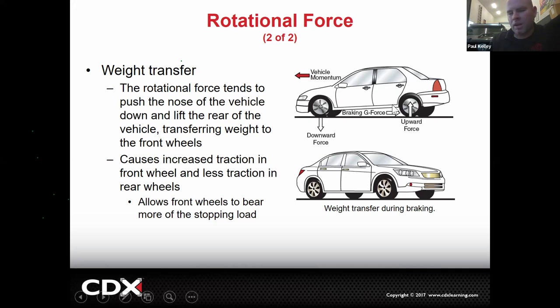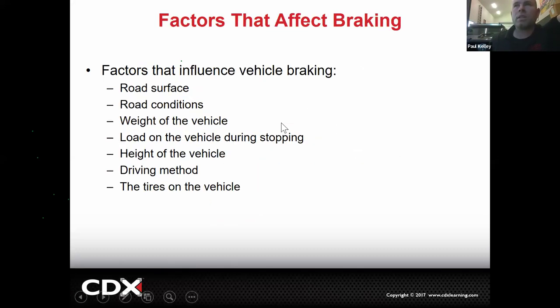And it's probably even more apparent if you're trying to go around a turn in the rain and you're going to hydroplane, you really need your best tires on the rear. And later when we do tires, we're actually going to show a video that's put on by, I think Michelin did it, but all the tire manufacturers agree, Michelin, Goodyear, Firestone, everybody who's anybody, all say your best tires go on the back. So this is also where tires kind of get related to brakes in the weight transfer as well. So it's kind of interesting.